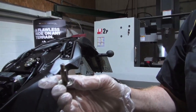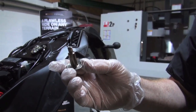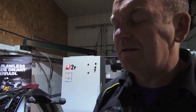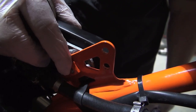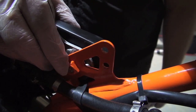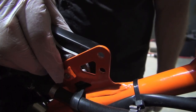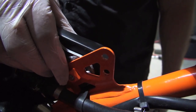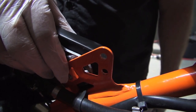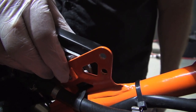So we've redesigned this into a two-piece unit, using an 8.8 high tensile cap head screw from the inside of the frame and then a separate stainless steel female thread. This means the nut that's welded to the frame — which is one of the items that can shear — is under compression rather than taking the force on landings. This nut is heat-welded onto the frame and can fracture even if the bolt doesn't break; the welds can fracture and the bolt will become loose. Using our two-piece unit, the nut is purely in compression, taking a lot of pressure off the bolt and nut, clamping it rather than fixing to it.